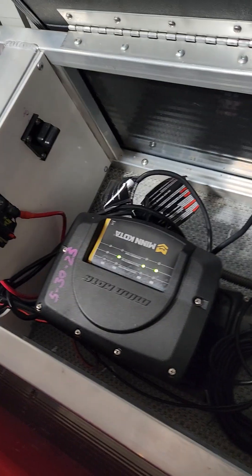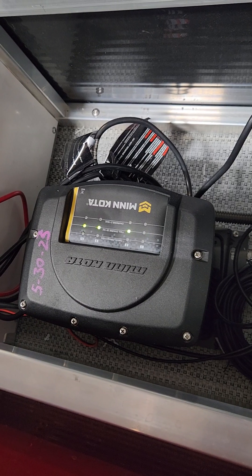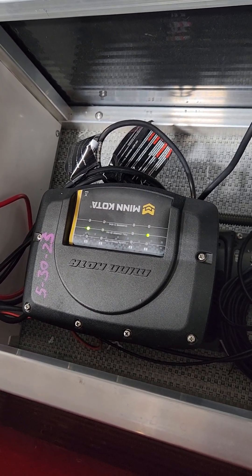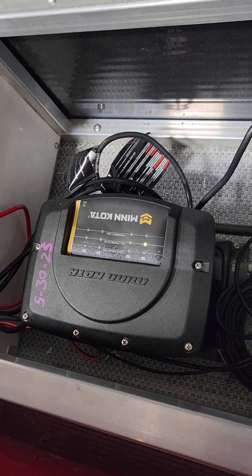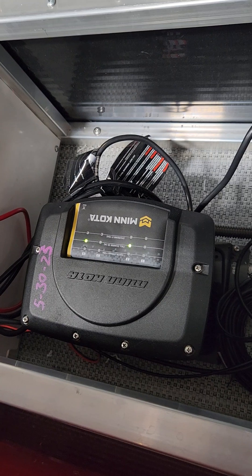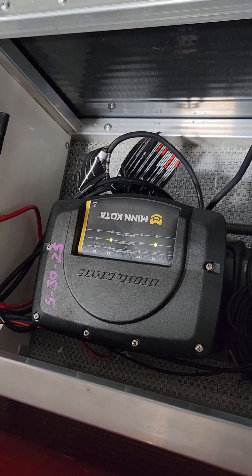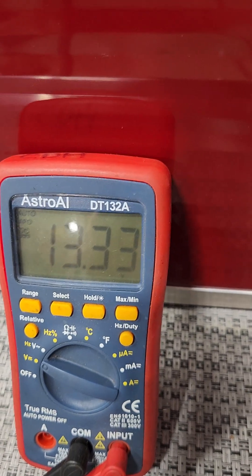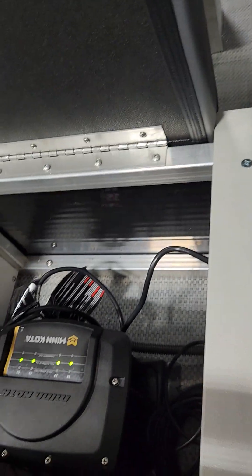While the lights do indicate what the charger is supposed to do, we have seen that the lights don't always operate correctly — the charger may not do what it's supposed to based on the light. If it gets to the point where it's flashing green but the voltage is still at 14.5 and not 13.2–13.3, that's when you have a charger problem.